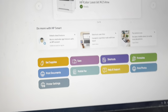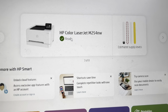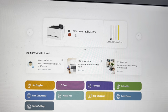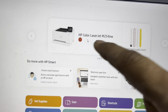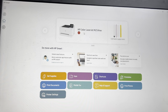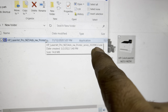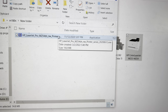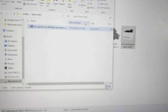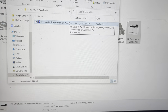I will show you on my laptop screen. Right now you can see it's showing ready, but now it's getting the blocked sign because there is an error. We have an old outdated firmware dated 12 June 2020. We will downgrade the firmware — I will add this file in the description of this video, you can find it there. We will double-click on the icon to downgrade the firmware.